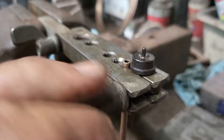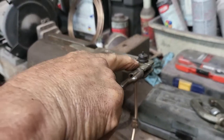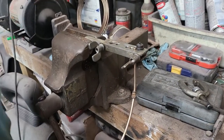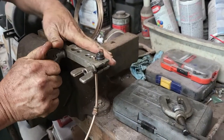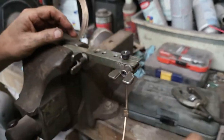You want to line it up with the bottom notch like you see here, then tighten down your brake line clamp tool — it's got a fancy name, I don't know what it is — but it lines up with that bottom mark. That's how you know you've got the right amount; it will mushroom and give you that nice seal that you want in a brake line, or whatever kind of line you're using this tool for.